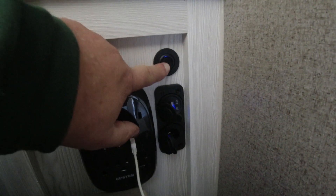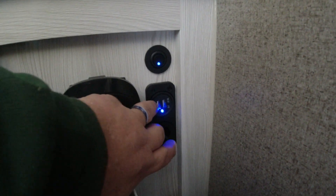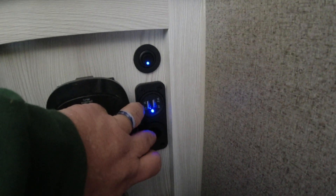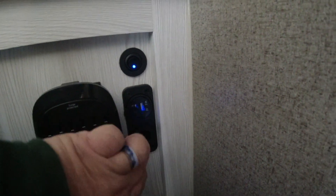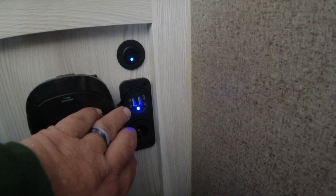When you're inside you'll see the USB at the top, and here's the switch — when you hit the switch it goes blue and also turns on the LED on the USB charger. I've got the bottom cigarette lighter socket live all the time because it won't be using juice unless something's plugged in, so I don't need to switch that one.